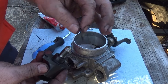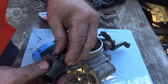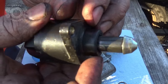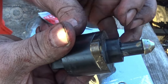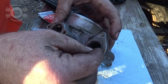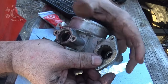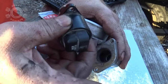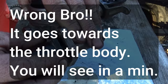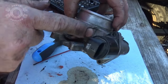Go to put your o-ring back in. Most people think you slide it on the IAC first, then slide it up and in — you can do it that way but it's actually the hard way. Take your o-ring and put it in the throttle body first. Notice there's a slight bit of a taper on the edge of the IAC — if you put the o-ring in first that slight taper will help you get past it. Otherwise if you put the o-ring on the IAC first, it has to compress against that sharp edge. With the plug facing away from the throttle body, go up inside here and gently rock it — there it goes, seated.